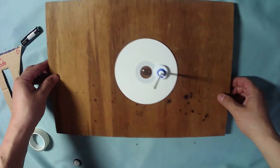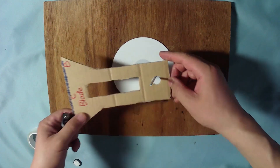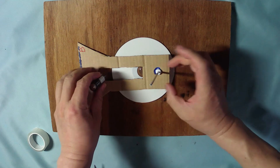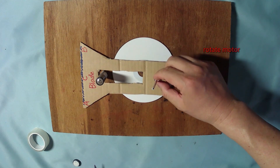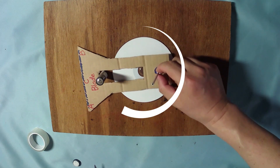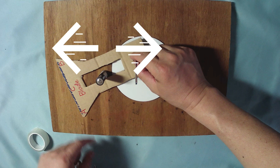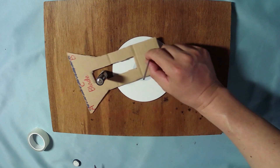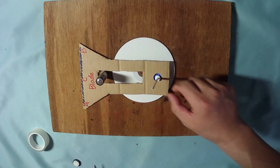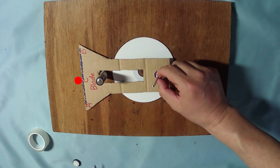We can use an eccentric wheel as a driving source. The mechanism is simply explained as follows: when the motor rotates, the eccentric position moves in a circle. The force passes through a stick to a specific position. Since these parts are restricted to moving only up and down, we convert the circular movement into a linear up-and-down movement, with an additional small swing. If the hair is in this position, the blade can cut the hair.